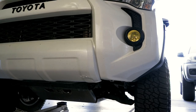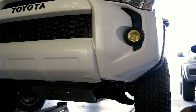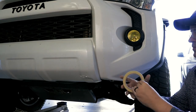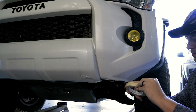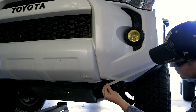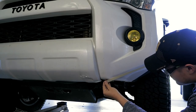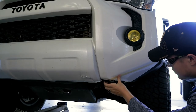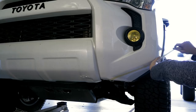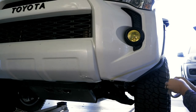Okay, so getting started. The first step in this process, like when doing any cutting, is to determine your line. For this project, I decided that the line we were going to cut on was going to be about an inch below where the bumper begins to turn back towards the tire. Keeping that in mind, I used some masking tape, picked my line, and laid down a strip of masking tape to indicate the point at which I would be cutting.